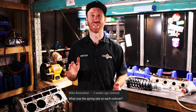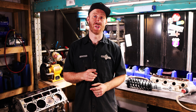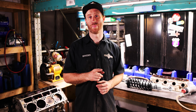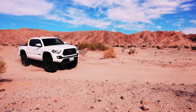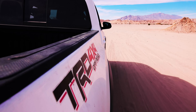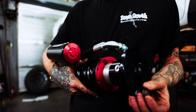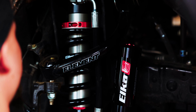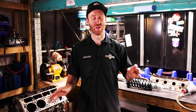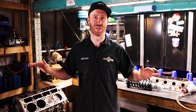All the shocks we tested have a 600-pound spring rate — we did that on purpose so it's equal. The only exception was the Elka, which comes with a 700-pound spring, but it rides more like a 600-pound spring. Everybody that buys Elkas with a 700-pound spring wants a 750, so they seem to measure spring rates differently — they're way softer than 700s from other companies. So it's kind of a wash; basically everything was a 600-pound spring to keep it level.